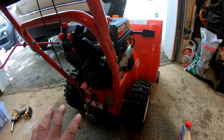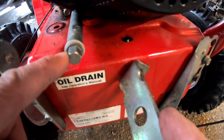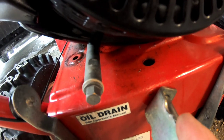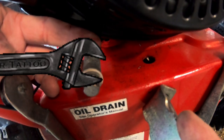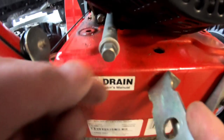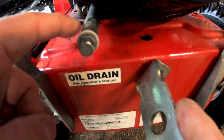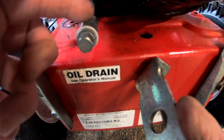Now if the oil was black, we would continue with an oil change. Basically, this is the reservoir right here with the screw nut onto this shaft — the shaft is hollow and goes right into the crankcase. There's a flat spot there, and that flat spot will allow you to put some kind of wrench in there to hold it from being turned — side channel locks or mostly a wrench. You would hold it there so that when you turn this nut counterclockwise, it doesn't also turn the shaft attached to the engine block. That little divot with a parallel flat spot is for you to put a wrench and hold the shaft so it doesn't turn.